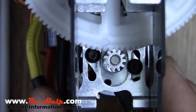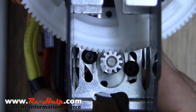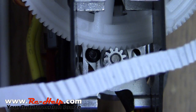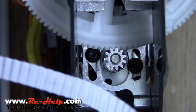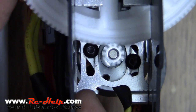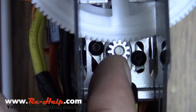Also, make sure you go through and click that motor one time and then check it. Click it again and then check it. What that's going to do is make sure that the pinion is centered on the motor shaft, and that the pinion is not actually too big for the shaft. So guys, do yourself a favor — throw that paper method away. The accordion effect, who cares? It's not going to set your gear mesh correctly. Set it up by hand just like I did here. Check it at multiple points around the main gear, and then check each individual click on that motor to make sure that pinion is centered on that shaft.